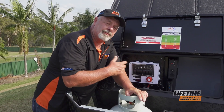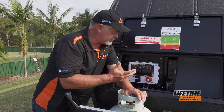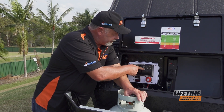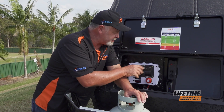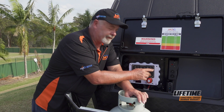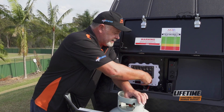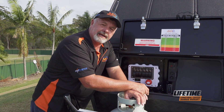When you're packing up ready to travel, you need to consider whether or not you're still running your fridge. If you're running your fridge while travelling, you need to leave the main switch on and the refrigerator switch here, which will maintain the power to the fridge slide. With that on and main power on, you're covered for the fridge. Everything else can be switched off. If you're not running your fridge, just turn everything off, hook up your trailer, and away you go.